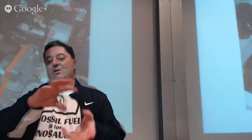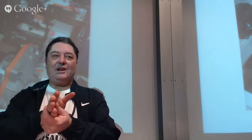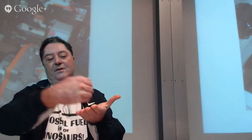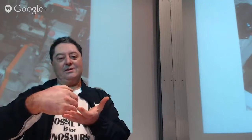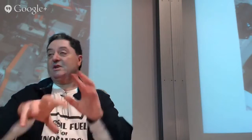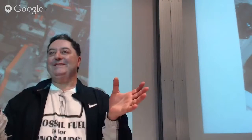This photo shows the motor end now with the end bracket. And the end bracket was quite unusual because the original engine mount, what we found is if we actually reversed it, it was dead top center and absolutely in line with the motor. The only thing we had to do, because it then took it off the chassis so there was no weight, we had to make a bracket to sustain the weight and bring it back to the chassis. But we just reversed the original engine mount, just turned it upside down, and it was a perfect fit. Fluke.